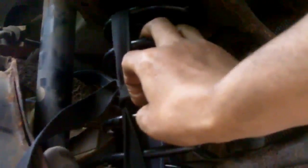Okay, so we have reattached, we've removed the jack from here, so the spring is sitting down, and I've still not reattached the shock absorber yet. I'm about to do that next, but what I'm planning on doing, rather than having to cut these, is to recompress the spring once it's in place, and maybe be able to untie these, because it looks like I'm going to need them again to do the other side. And these are fairly strong. You have to make sure that you tie the right kind of knot, nothing that's going to slip. I still wouldn't say that it's, generally speaking, safe, but to put it into perspective, just one of these is more than strong enough to tow a car of this mass. But anyway, the job continues.